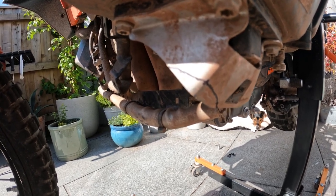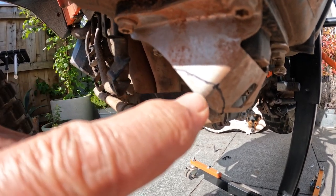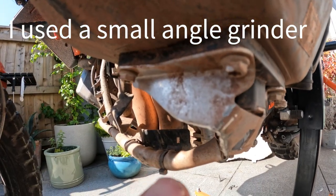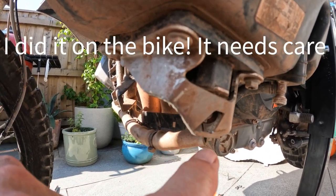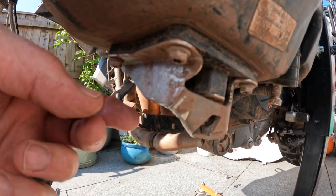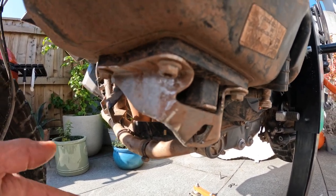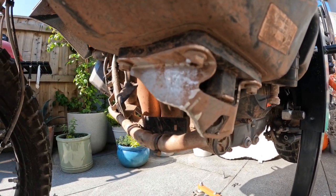The other thing on the AXP site — they can do modifications on the bash plate itself by cutting the plastic. But I think this isn't going to harm anything by taking a bit of this off. So I've just reshaped this a little bit — I've not taken anything off this bit here, so the strength around here stays the same. But I've taken off quite a big corner here which I don't think will impact the strength of that protector. The plate now sits underneath it with no touching — there's probably about a 3mm gap between them.